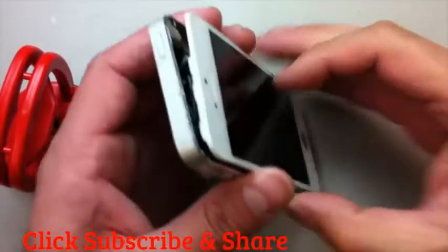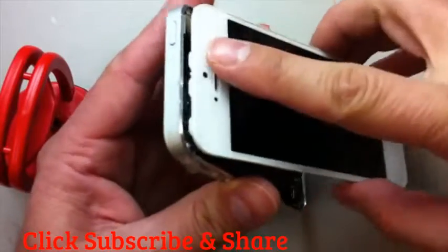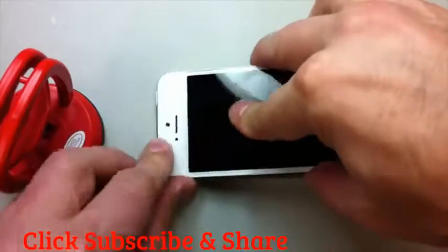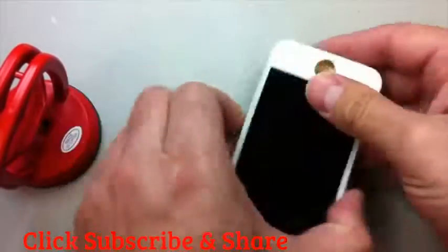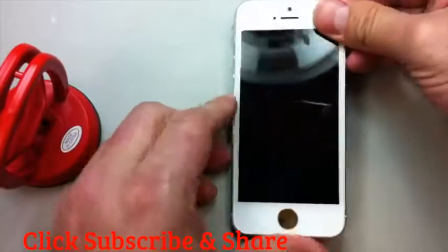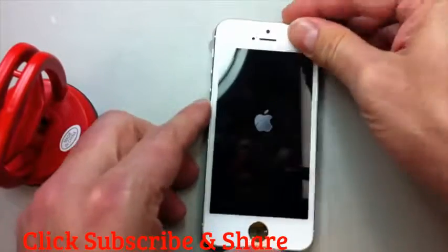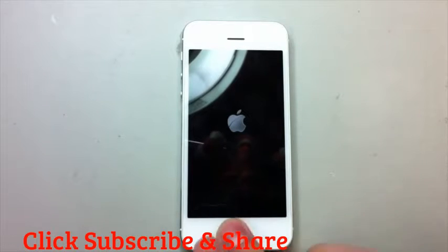And over here on the top of the phone, you're going to notice that there are 3 tabs, and you want to make sure these tabs tuck in under the top half of the frame, and once you have them in position, make sure you keep that tucked in, and then just very slowly work your way around the edge of the glass. Don't push too hard, especially in the areas near the LCD, and make sure this all sits together flush. Once it does, we'll power it up, and I'm going to speed up the video here just a little bit because this thing takes forever to turn on, and it's not even on 7.0